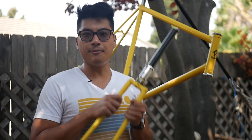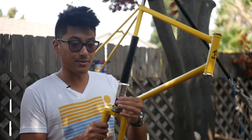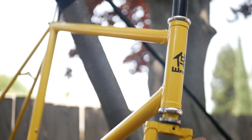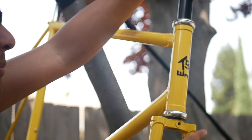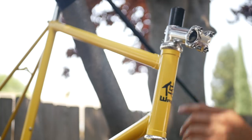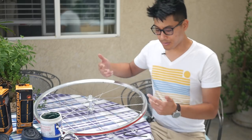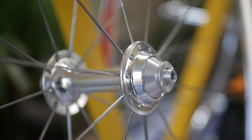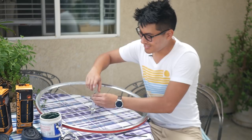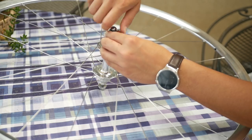Next up, we're going to install the fork and the headset and spacers. What we'll do is just take off the top cap, take off all of these spacers along with the top of the headset. Next, we're going to slide in the fork and then put on the top of the headset. To keep the fork on, slide on a stem and then tighten the side bolts. It doesn't really matter if the stem isn't entirely aligned with the fork since this is just a temporary thing to keep the fork from falling out of the frame. Now we're going to put the wheels together. These are a fancier set of hubs with allen key bolts; yours probably will have track bolts. Just grease up the bolts — hand tighten them for now since we're not putting them on yet.